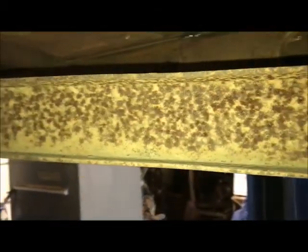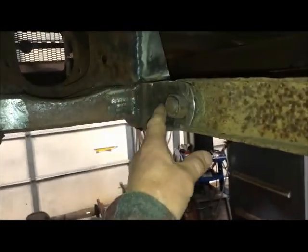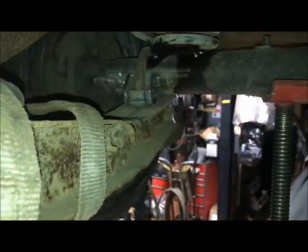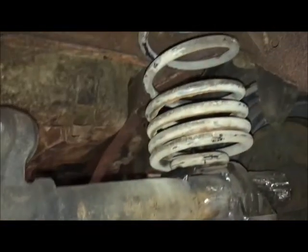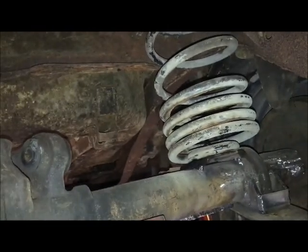Okay, so quick overview of where we are with the rear suspension. So put in the 2x4 steel cross member, made tabs out of 1/4 plate, truck arm suspension, boxed the rear sections of the rails, and I bolted the rear springs in. So all that's left to do are the rear shock mounts.